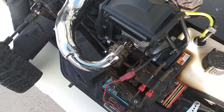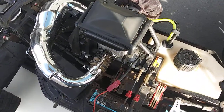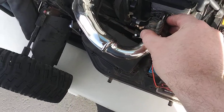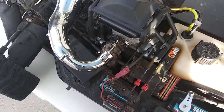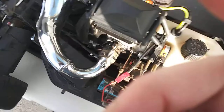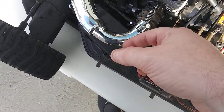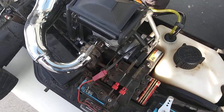Right now you can notice I got the DDM Dominator pipe on there. I tried the Victory pipe for the DVXL and it didn't seem to fit right. Just where the header connects to the exhaust, straight from the gate, it has like a curve in it, and then it makes it so it doesn't seal really well right here. With the Victory one that's for the DVXL, right from the header there's a curve that just curves this way, and it makes it so you can't seal it worth a shit. That's the dumbest design for an exhaust — a curve right off the header. If it's all one piece it's not that bad, but this one was two separate pieces, just like this is and like most exhausts are. So the Dominator one works good.